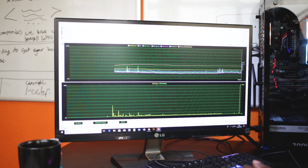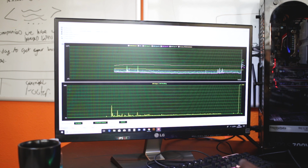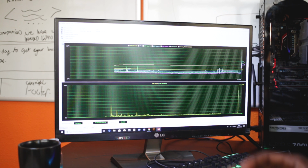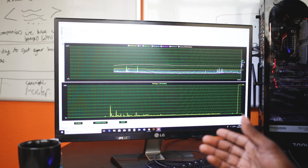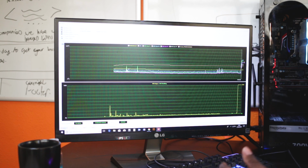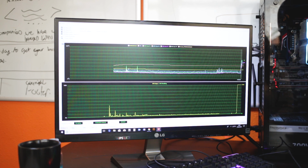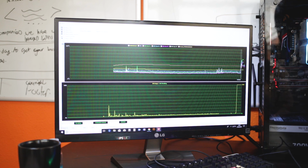The fan's gone up, but it's not really that much of a difference, so it's still hardly audible. But it looks like one CPU core has gone to 65 degrees, or it's gone down to 57. Now remember, this is a stress test, and the CPU is not overclocked or anything like that. And I've got no fans at the top, but I've got one exhaust fan and one fan for the CPU. So let's see how it does for 15 minutes, then come back.